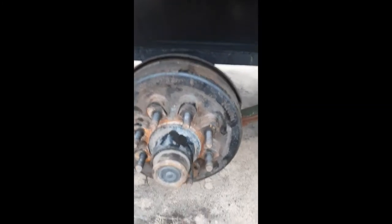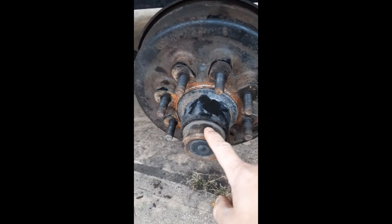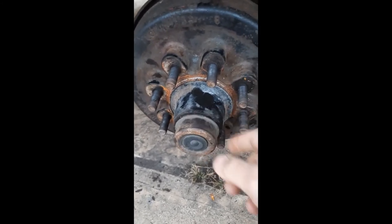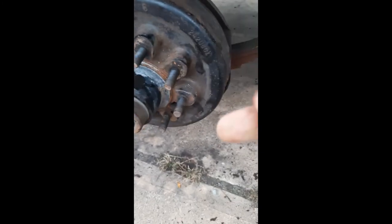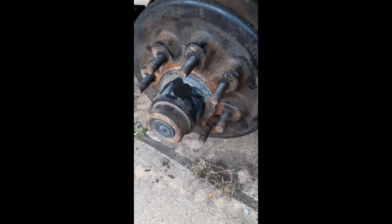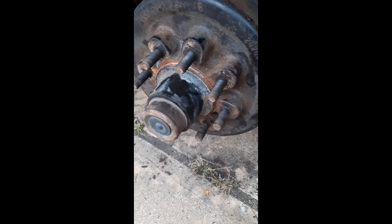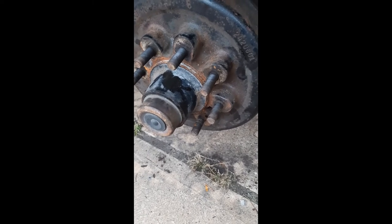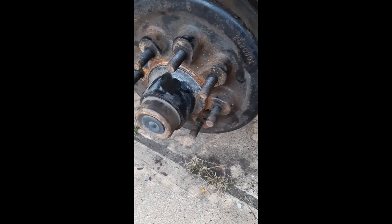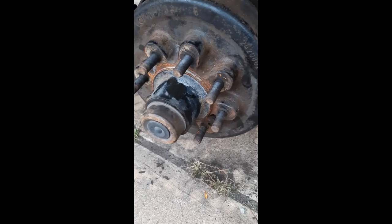The only thing left — and I adjusted the brake, which was pretty involved. You pull this cap, take the nut out, take this whole drum off, and the wheel bearing is going to come out of this side. Then there's a spring on the bottom that has an adjuster. You're supposed to be able to do it from the back — there's a little hole in the back of this plate — but it's a pain in the ass to get to. They hadn't been adjusted in a long time so the adjuster was pretty seized. I had to spray it with some WD-40 and then put it in a vise and get it with a pair of pliers to get it to turn, so there was no way I was going to be able to adjust it with a screwdriver.